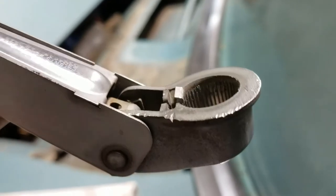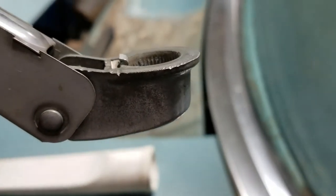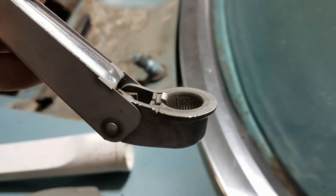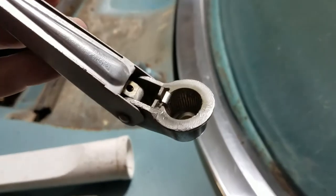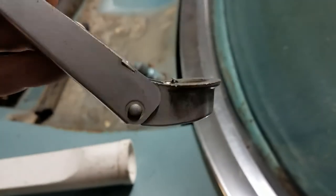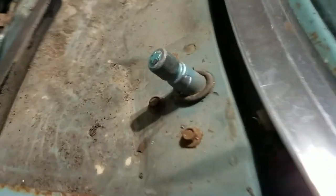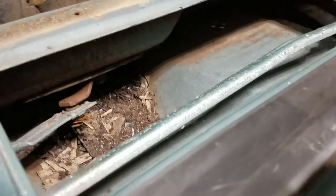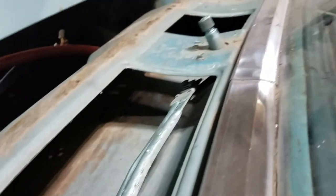The tab has to be pushed away from the pivot and then the wiper can be pulled off. It's a little tough because they want to become seized on there. What I do is put a paint stir stick down on the car and then pry up on the outer edge on the right-hand side while pulling on the other side, with another screwdriver wedged in there to hold that clip open — then it'll come off. These can corrode together; I think the end might be pot metal. It has little splines in there so you want to make sure you don't booger those up getting it off the pivot.